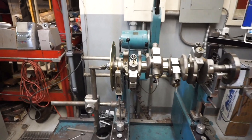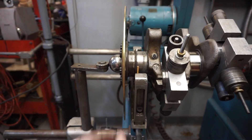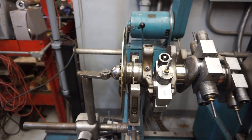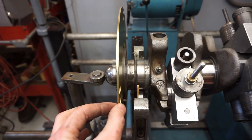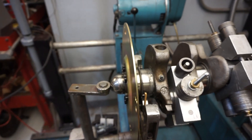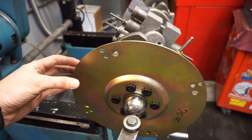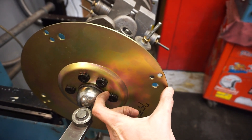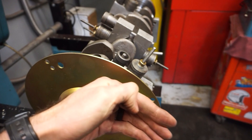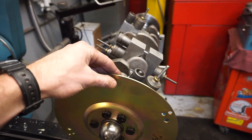Another crazy thing to think about: when you look at the flex plate from the side, it's just this little 1/8 inch piece of steel, and you wonder how 5, 6, 700 horsepower gets transferred through such a thin piece of metal. But really, it's all laterally transferred — it's not bending and flexing across it. It's not transferring power like a dinner dish; you're looking at the whole width of the metal because it's all spinning this way, so all the strength is that way.